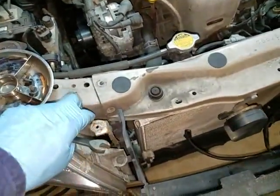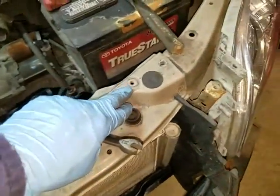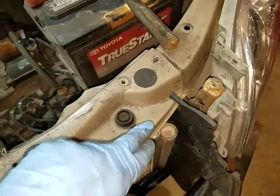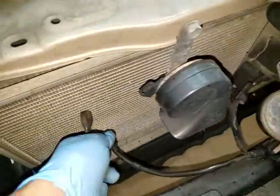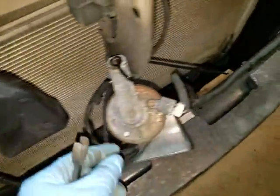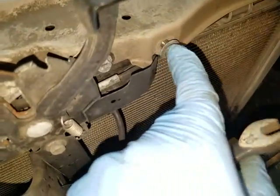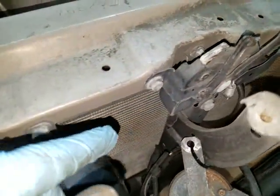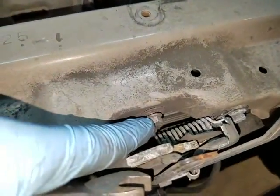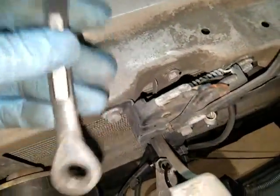So I'll remove the two bolts here on the air box and the two bolts over here. I disconnected the horn — this one I couldn't get the wire out so I just unhooked it, which was right here — this is a 12 millimeter bolt. Now what I think I can do is I'm actually removing this bolt here, which is 10 millimeter. Make sure you have a ratcheting wrench for that.